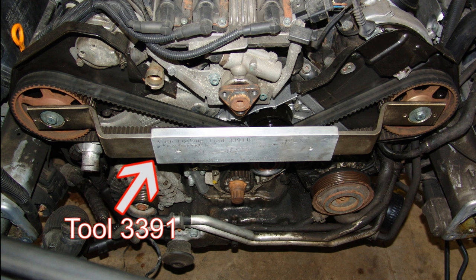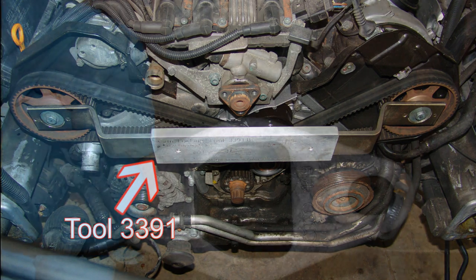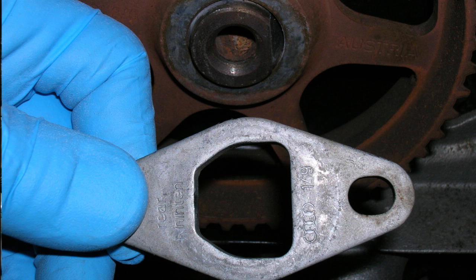The camshafts do not have keyways, they are tapered camshafts and are held in place by the conical shape of the camshaft and pulley being tightly pressed together when tightened. For camshaft timing reference, the two largest holes on each diamond-shaped camshaft washer should point directly inward.